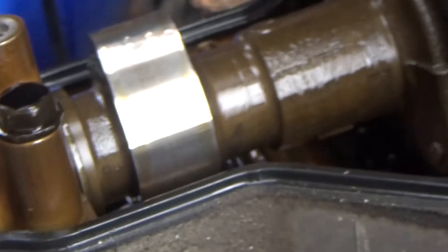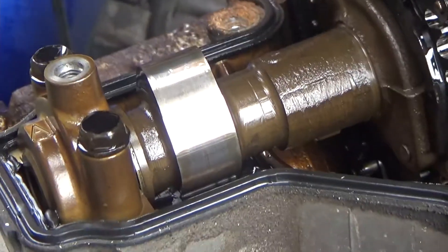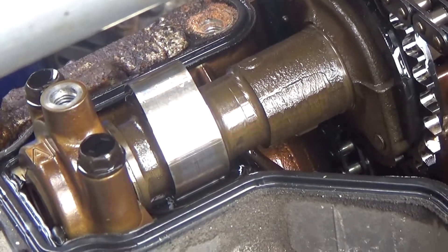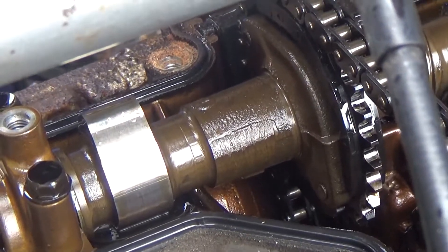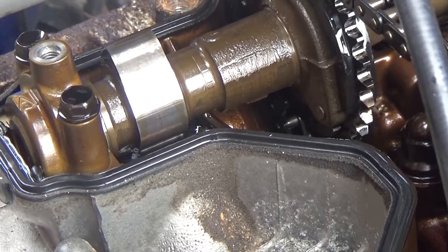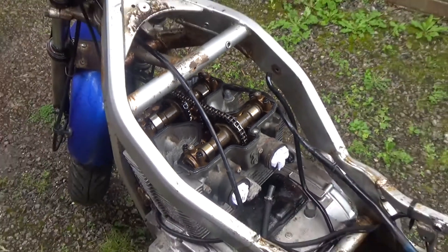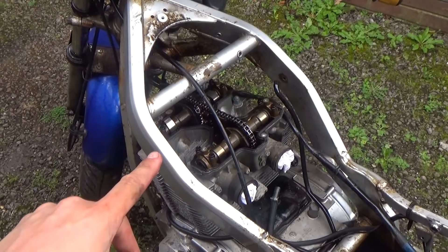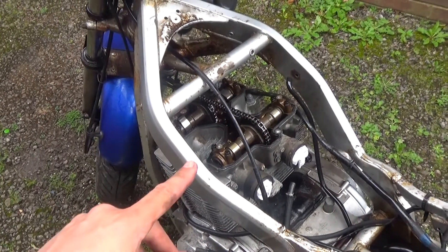So there's the problem — it's exactly what I thought. I'm pretty sure that's the reason the guy got zero compression and not a burnt valve, although too tight an exhaust valve could lead to a burnt valve if he'd been riding with it, as it would be leaking exhaust gas and slowly eroding. The head may still have to come off if after I change the shims I'm still getting low compression — the valve might need lapping or replacing, and hopefully the head won't need a valve seat job.